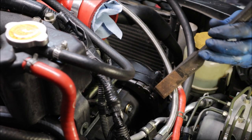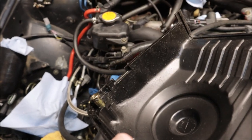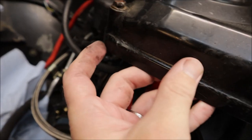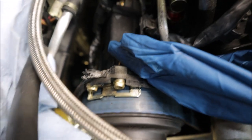Off-camera, the punch method from the back did not work — you just keep banging on the cover and it springs back. The heat method did not work either. So now we're going to resort to the chisel or drill method. It makes me nervous because there is a little guide that goes under here as well. Well, the front cover is off — one side at least. You can see all the oil and crust built up. I tried to cut one of the front bolts off but it was taking so long. So the best thing was to just chisel through the actual rear cover part that holds the bolts in, and then pry the front cover off. Clearly those rear covers will have to be replaced.